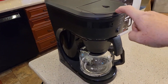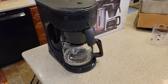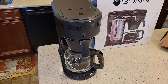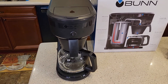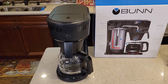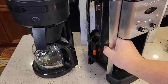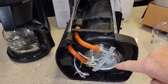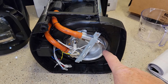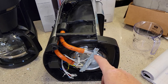After the fourth time, let the water drain out, then you can turn your switch on, and then you're all ready to make coffee. You will have to wait 15 minutes for the internal temperature to get up to temperature. You're supposed to do this every three months — it is really important for Bunn coffee makers because that heating element is working a lot, keeping that water heated all the time. It doesn't know when you're going to brew your coffee, so it has to keep it hot all the time. Here we have a typical coffee maker where you put the water in the back, and it heats the water just when you're ready to brew. That's why regular coffee makers still need descaling, but not as often as Bunn.